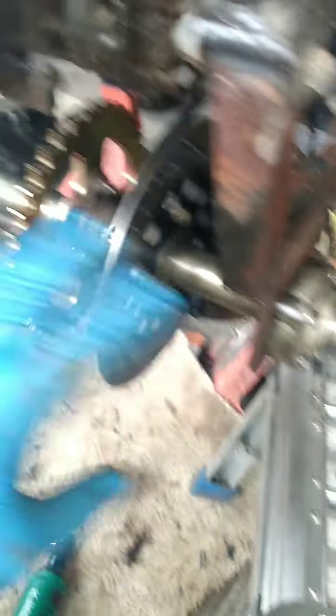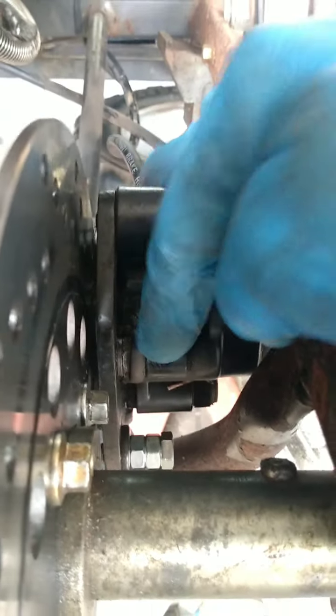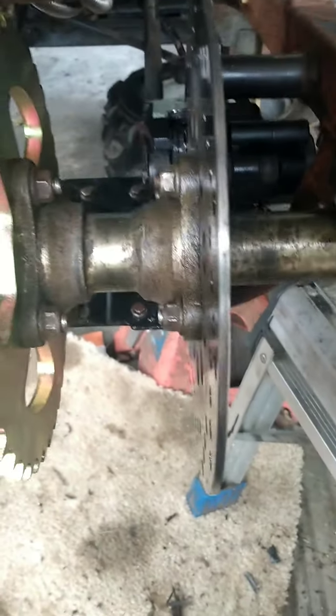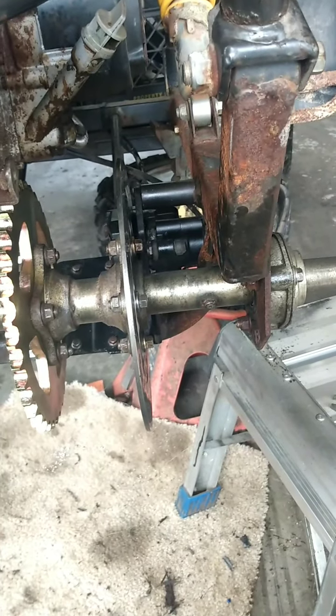Back at the Felicity Tucker garage. We got the hubs on, the axle on, the hubs together, the sprockets on, and the new brake shoes. I was missing a bolt down there and didn't have a shorter one, so I just put two nuts on it — works out perfect, long enough and doesn't get near the sprocket. Side note on the brake caliper: it sticks. It's supposed to ride back and forth on this part here as well as the pads on their own little clips. Mine's not quite free, so make sure you clean that up and make sure it moves freely before putting it all back together.